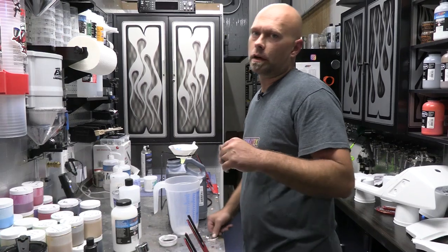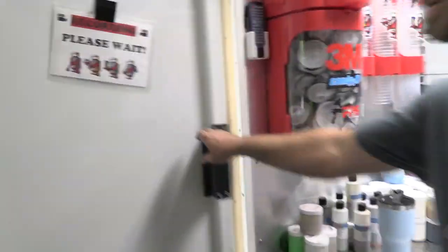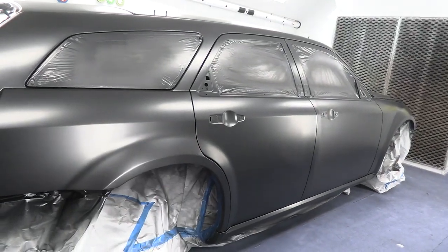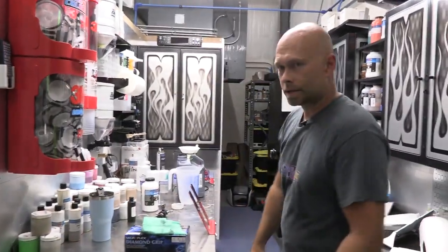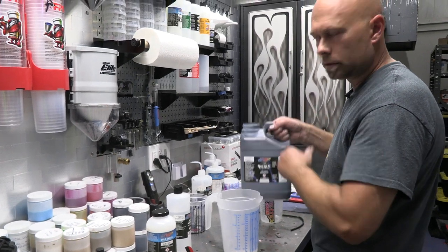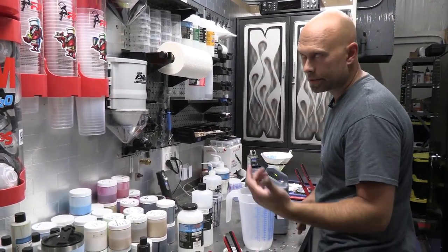Our second coat of sealer is on — we opted to do two coats. The first coat I put down, I looked for any kind of issues in the sealer itself. It looks like velvet in there — nice, smooth, really slick. I don't see any issues except where I tripped over the air hose and got a little drip, so I've got to fix that. Now we're going to take this opportunity to mix a little base coat. For this car it's going to be two-tone: the top is going to be our wicked pearl black, and the bottom we're going to do our wicked charcoal metallic.